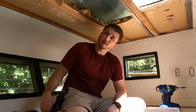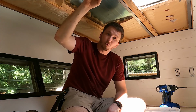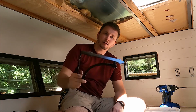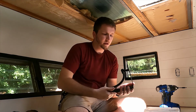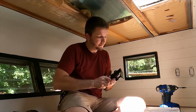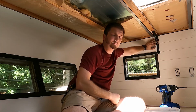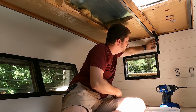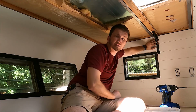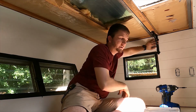So the majority of the weight is going to be transferred to the wood through all of the screws that we're putting in. The steel is going to help the wood stay more rigid. And then we've also got these shelf brackets. We got these on Amazon, links in the description below. And the idea of this is we attach it to the sidewall right like that, and it supports the wood. And by supporting the wood, it also supports the steel. So this will provide a little bit more of a support mechanism for this steel support that we're putting in. But that's the idea, and that's the plan.